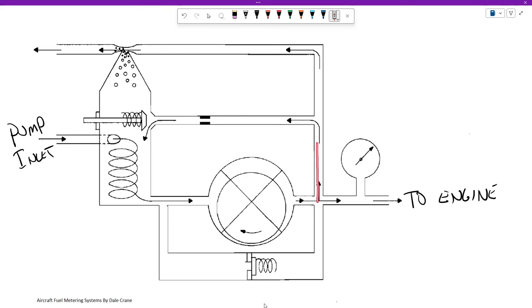The recirculation path goes up and back. There is also a path that always goes back to the fuel tank — this is always open and you can't shut it off. At a venturi in this path, when fuel accelerates through it creates a low pressure area, which draws out any air bubbles from the swirl chamber and sends them off to the tank, ensuring bubble-free fuel heads to the pump.